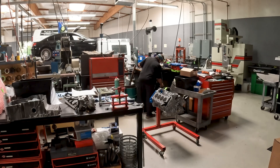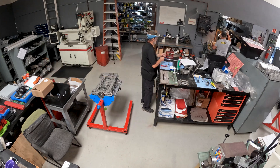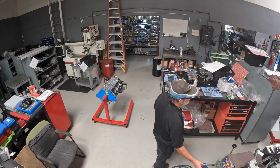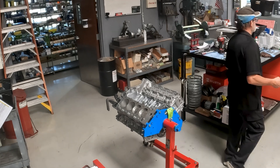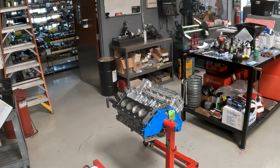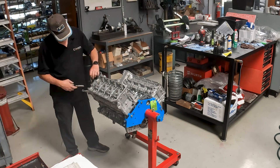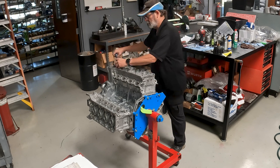Now that I've touched on the inspection process, the boring process, and some of the components, let me talk about the assembly process at the engine building facility. First, they set the piston ring end gap, measure and adjust the rod bearing and main bearing clearances, assemble all the rod piston clips and rings, and install the oil squirters. After that, the crankshaft is torqued down to the bed plate — because this is a bed plate motor — and they check the end play and rotation of the crankshaft. Then the pistons go in along with the oil suction pump, they set the backlash on all the gears, install the oil pressure pump, install the pickup tubes, and check the piston and deck height for the correct head gasket thickness.